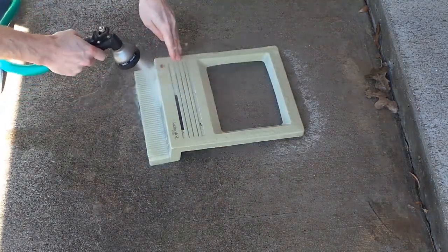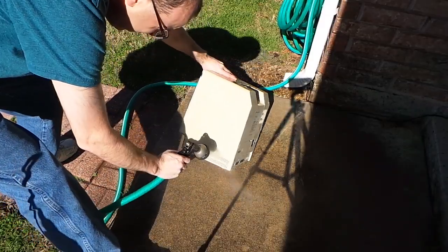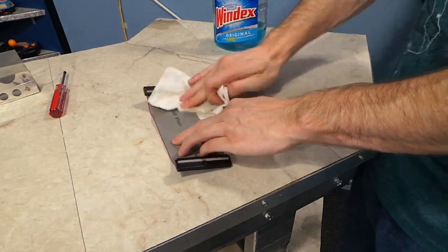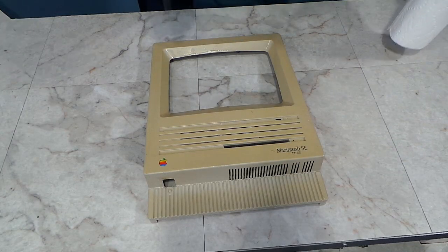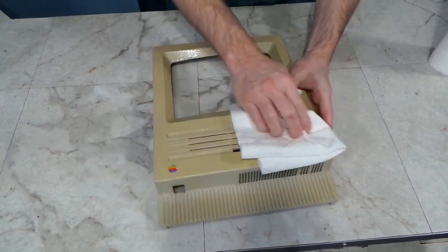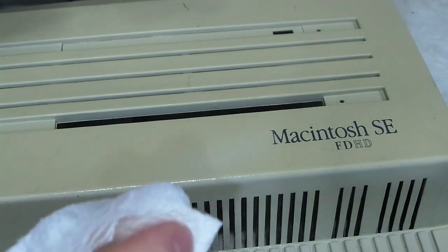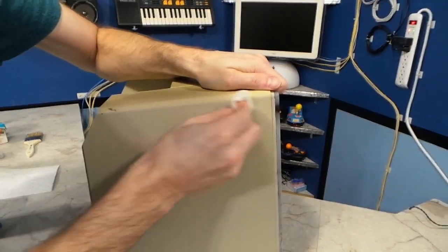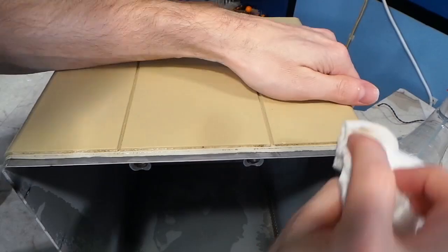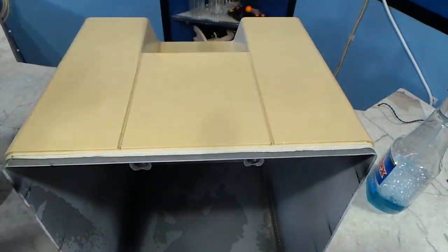I always use compressed air spray to clean out all of the vents and crevices on the machine. I clean pretty much every part I took out, no matter how trivial it seems. I pay a lot more attention to the exterior case pieces — it's very important to get this super clean. While Retrobrite is an important step, a lot of people neglect the all-important process of hard scrubbing to get all the marks and imperfections cleaned. Sometimes these marks seem permanent, but there's almost always some way to get them off if you're willing to put the work into it.